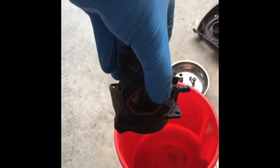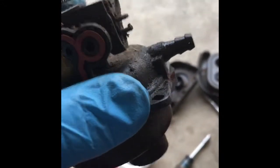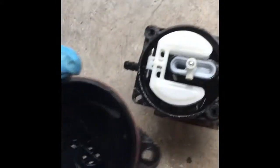I'm using an old Folgers container — I like to do this to capture any fluids. Some people use an old water jug or milk container. When you open this up, there are a couple of places where you can get a small flat screwdriver in to pry it open, but first undo these screws. Before you open up the bottom, just spray it all off with some carburetor cleaner. Get a small flat screwdriver, put it in there, and use the tension on the other side to pry it open.